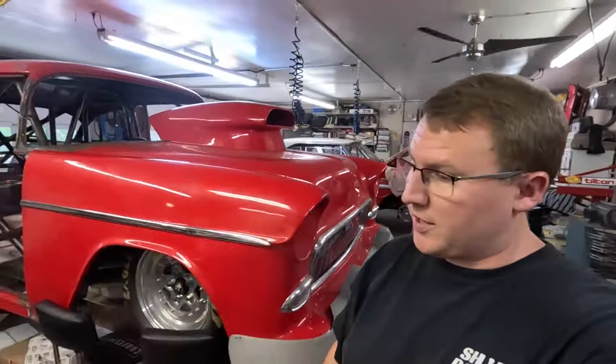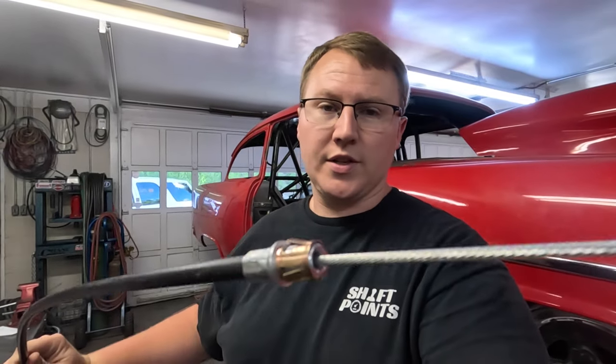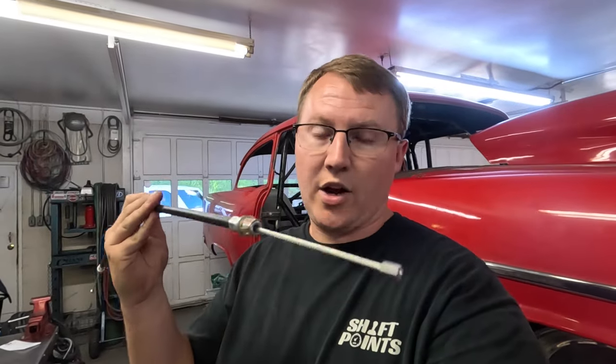So Dad came out. One thing that we ran into yesterday while we were looking at the rear brakes on this thing, I was getting the emergency brake stuff kind of figured out. The emergency brake cables, these guys right here, that have the sheathing and the wire cable that runs through them, as you can see right there. If you mount this side on the side where the stock ones were mounted, they're actually too short for them to clip in at the caliper.